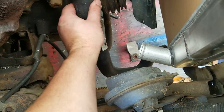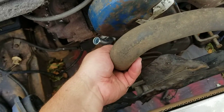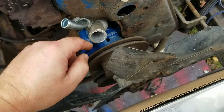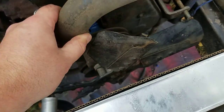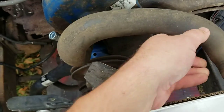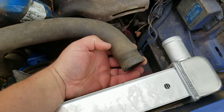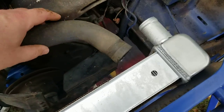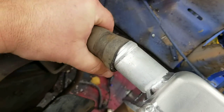This is the top hose. This is the original hose and I put a new thermostat housing on — it didn't quite line up, it's a little bit different, but we made it work. For some reason that hose doesn't go all the way down. I don't know if the radiator kept it pushed up or what. I might be able to sneak it over the top or slice it here, put a piece of tubing in, and make it work.